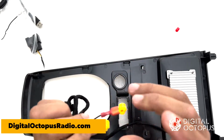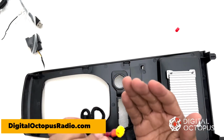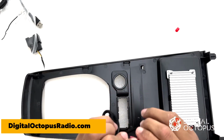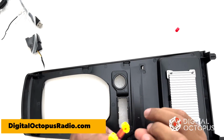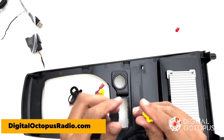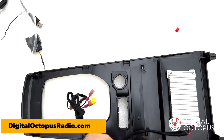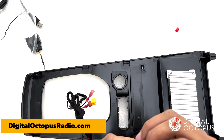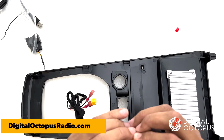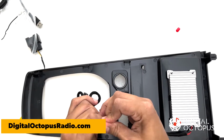Make sure you use pliers when you use these T-tabs. Sometimes people try to squeeze it with their fingers and it doesn't work like that. You need to squeeze it with pliers. Make sure that the wire that's inside cuts into the wire and makes contact with the wire on the cigarette lighter. So there it is. That wire needs to cut right through, and it needs to make a connection in there. If not, it's never gonna work. So we're gonna put this here.